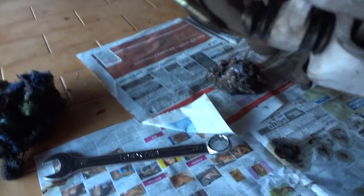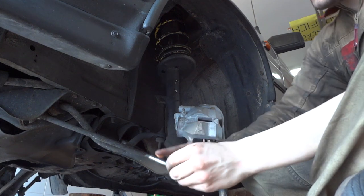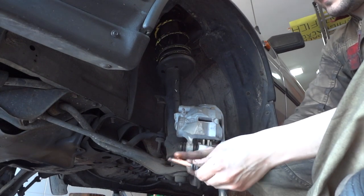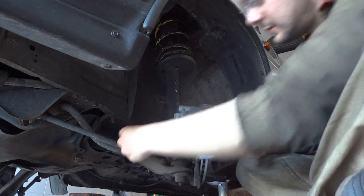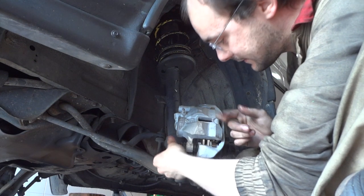And then for the guide bolt that goes into the bottom bushing, I'll be coating it with anti-seize compound. It's a coppery paste. So, there it is. Because the bushing may slide, it's always a good idea to have lubrication there.